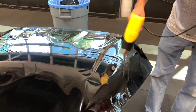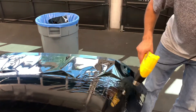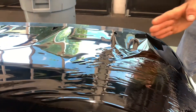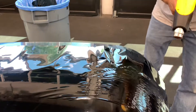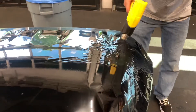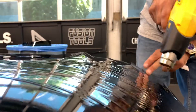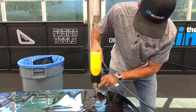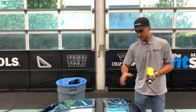Notice I have my right hand on the heat gun because I'm right-handed — I want my good hand on the heat gun. I'm not going to the middle. There's a ridge doing this in the film — I want to pull that towards the easy area. So I'm going to grab the film and pull it to make it go towards the easy area. Boom — that ridge is gone. Quick fast wiggles back and forth, fairly close — about an inch, maybe a half an inch at times. The key thing is not going to where it's easy, which takes discipline and awareness, because naturally everyone wants to go to where it's easy since it's satisfying when you see the film suck up tight to the glass.